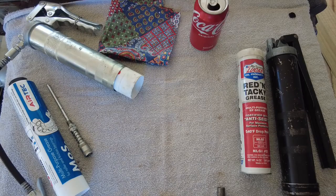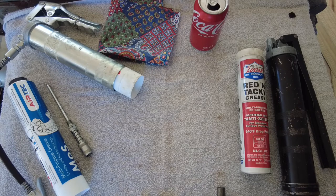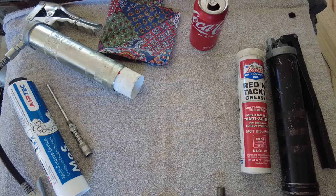So what's a grease gun and why would you need one? Well, a grease gun is basically some type of device that forces grease out of a container into a closed area. So if you had ball bearings and axle, bushings or moving parts on a forklift — especially in cars and trucks — the suspension parts in the front, the steering rack, what makes the tires turn left and right — all those things have grease fittings.